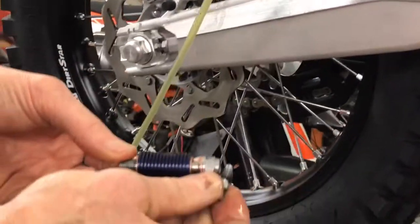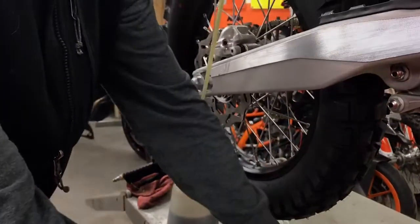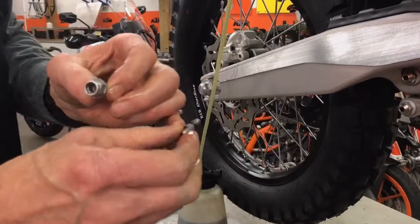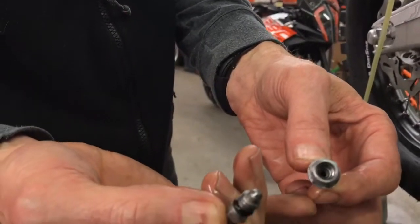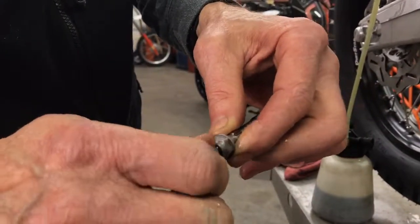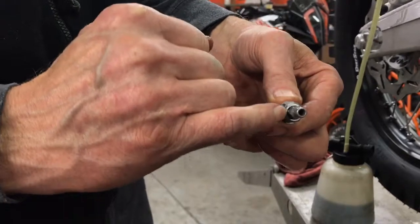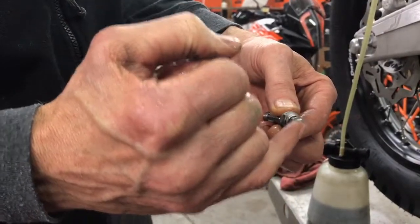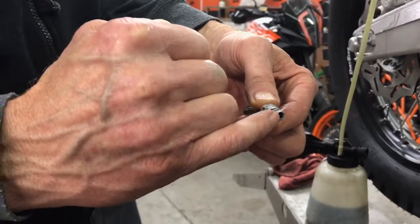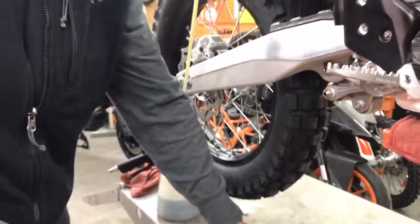And here's the new trick that Magura worked in. Okay, we take apart our kit, and this is it. Banjo fitting right here in that order. Just gonna install this, and you can see here this new O-ring fits into a gland here, and seals so that when you bleed air, opening this valve, air is not drawn in right there at that thread and then exits as you bleed, and then you as the mechanic are mistaking that air that got in right there. You're mistaking that air for air in your brake system, which is really counterproductive and frustrating. So they solved that. So go get them, Magura.